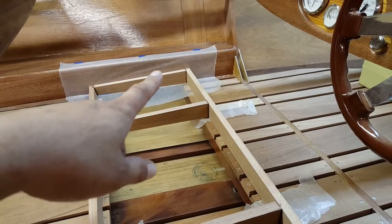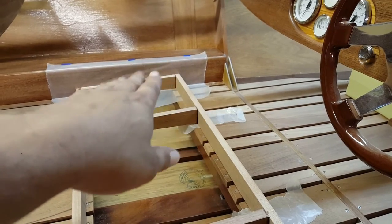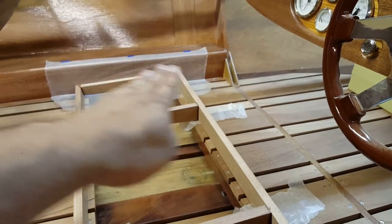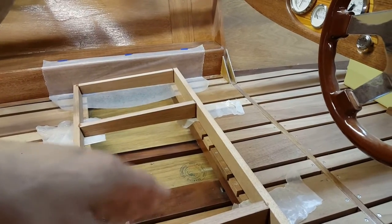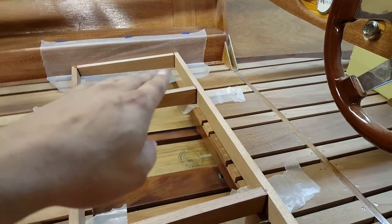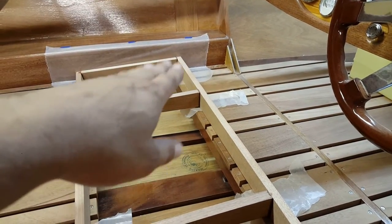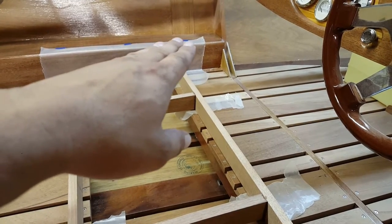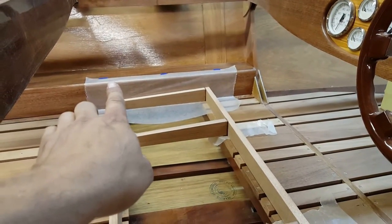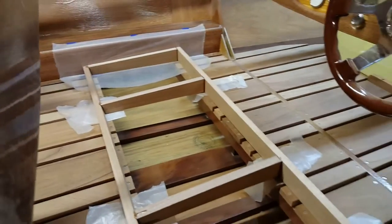So what I did was I wanted my seat height in the front to come out about level with the armrests. So we've got 2.5 inches. Now, I decided to use a piece of half-inch marine ply for my actual seat base that the upholstery will be attached to. So you got 2.5 inches plus that half-inch thick marine ply that'll go all the way across here. Then you have the 2-inch high-density foam on the top of that. So you got the 2.5 plus the half is 3 plus the 2-inch foam will put it flush right up here at the tip. And then as it goes towards the back of the seat, it'll be below the armrest back here by about 1 inch. And so that'll give you a slightly reclined seating position.